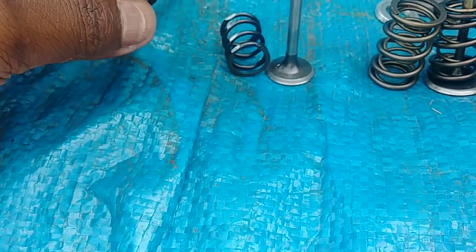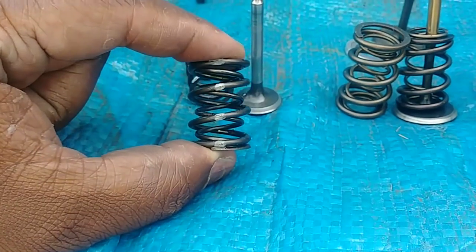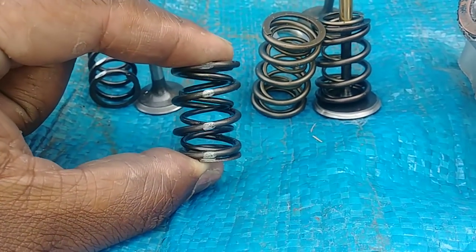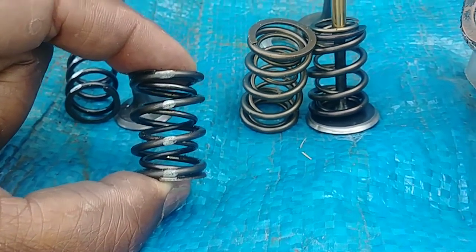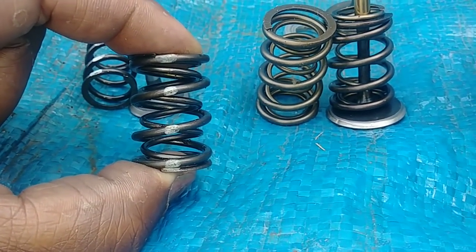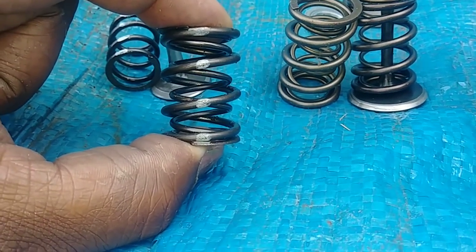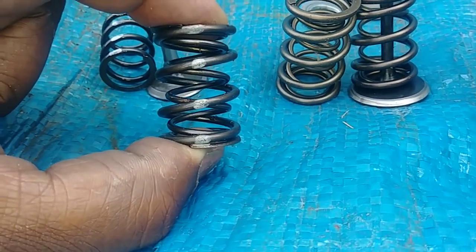And this is the most common, this is what I normally use in most of my big valve small block heads. This is like the most common with a 32/28. I run this white stripe dyno, and it's good up to actually 450 lift, right? But I normally install it so it can run a max of, say, 440 lift, only because I get a little bit more spring pressure. So the difference is only like 2 pounds, you know.